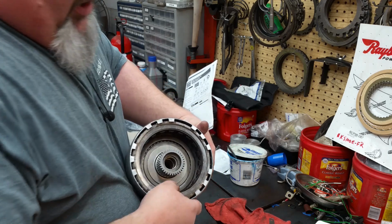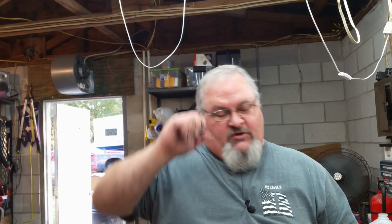And we've taken all of our measurements, so that's going to do it for the input housing. I left the seals off for a reason, because that's going to be in the part where we put the case together. As you've seen me do, we check our clearances on our clutches to make sure they're good. The 3/4 is a little on the tight side, but I'm not disappointed with it.